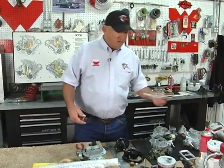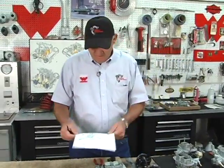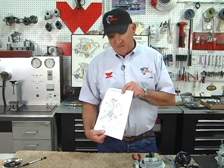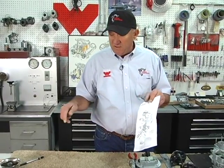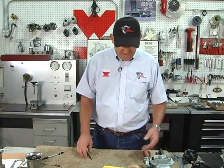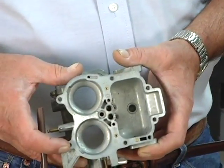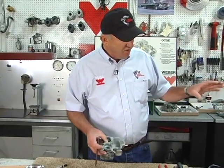All right, at this point right now, here's my feelings. If what you've seen, with the help of just some simple resources, like the Weber tuning manual for the basics and stuff on the Weber carburetors, also available at Pierce Manifolds, and the exploded view that comes in the rebuild kits, breaking everything down, and what we've discussed here, you should be able to, number one, make the decision whether you should even be rebuilding your carburetor. Are the throttle shafts worn? Are the mixture screw seats bad? Are the idle jet seats bad? Is there so much corrosion in the bottom of the float bowl from water that, you know, is it a rebuildable carburetor?